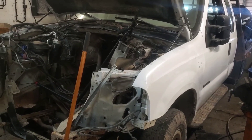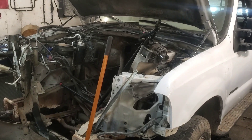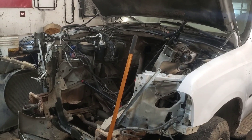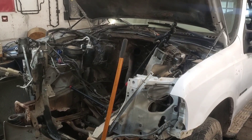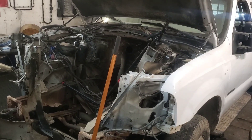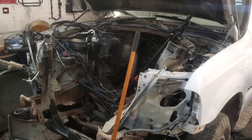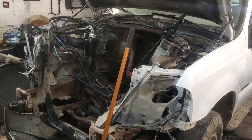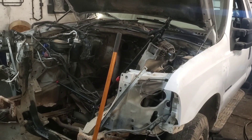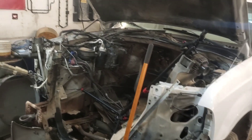Welcome back. A few weeks ago I did a video with this 1999 Ford F-250 or F-350 with a 7.3 Power Stroke. It had a low oil pressure problem. It was fine when cold — you'd hear a little knocking — but once it warmed up, driving down the road you'd have about 25-30 PSI at 1800 RPM. But at idle, like at a stop sign, the oil pressure dropped down to almost nothing, and if you let it idle long enough it'd start running like crap because it was basically running out of oil for the high pressure oil system that runs the injectors.